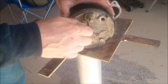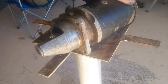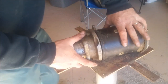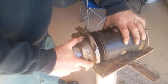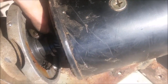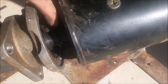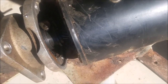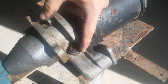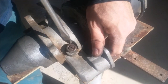I believe I was wrong — those are short bolts. I'm not sure why this isn't coming off. I think I'm gonna smack it some more. Now it's loose. There's a fork in there right there that engages the Bendix from the starter solenoid and makes it flop like that — it's stuck in there. I gotta figure out how to get it out. I think there's a set screw and a nut up here, and I noticed the nut's already loose. Normally you'd loosen the nut and then loosen the screw, but it's already loose, so I'm just gonna take it right out of there.